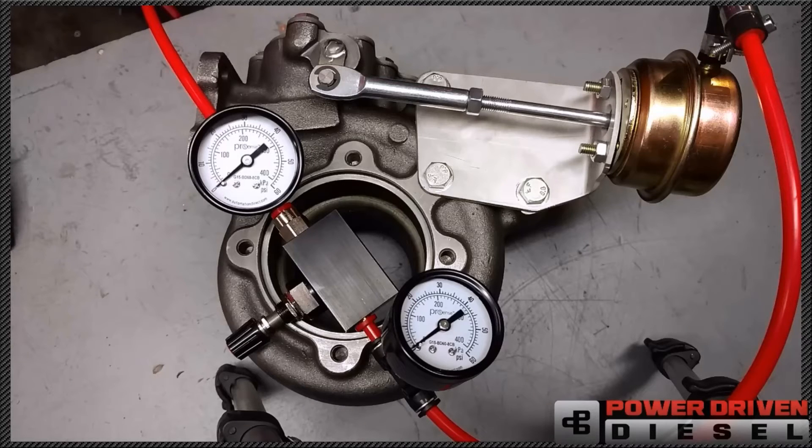So if you had enough fuel to get that high, you'll hit 35 psi. If you have more fuel, you may get higher. It starts to crack open at 10 psi. We want to slow that down. For a turbo diesel performance application, we're going to want a lot more boost than that — any performance application on a diesel truck is going to need way more than that amount of boost.